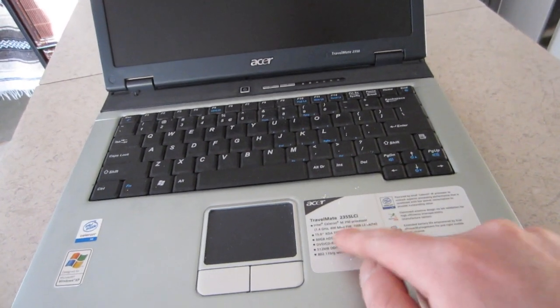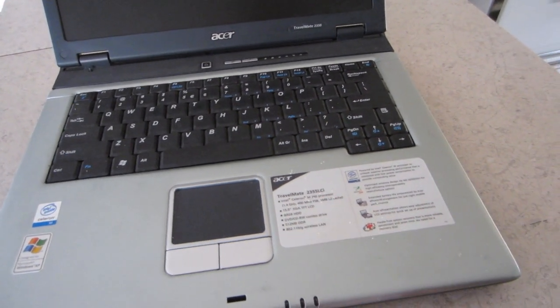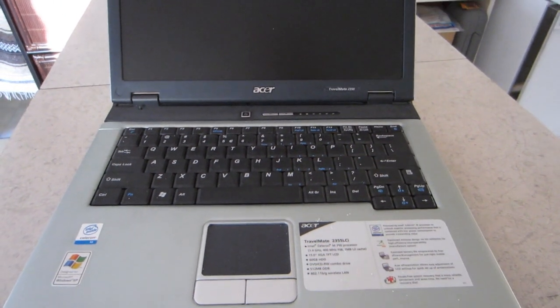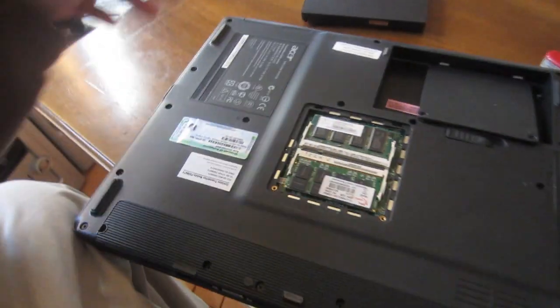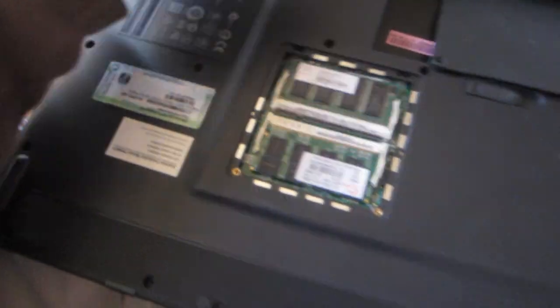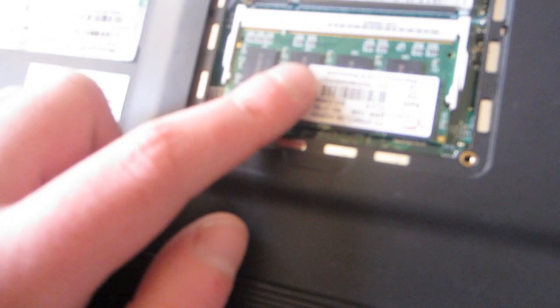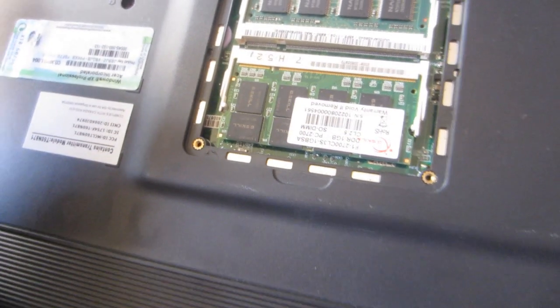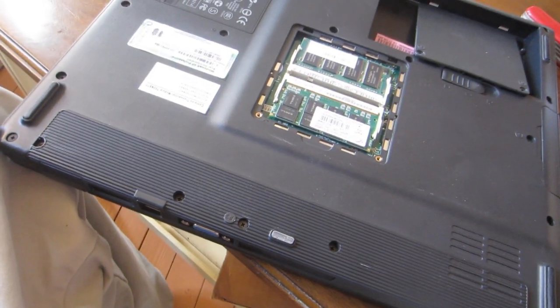It's a Travelmate 2350, so it's actually a little bit smaller and looks like it might be a little bit faster too — same CPU though. Let's take this thing apart and see if it has any parts we can use. Unfortunately this one doesn't have easy access to the video card — I'd have to take the whole physical case apart. But one good thing I did find is someone upgraded this to one gig of RAM. So I've got a free one-gig stick I could put in there and speed it up — score, I like free parts.